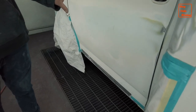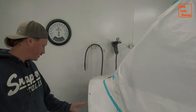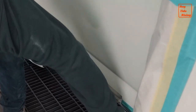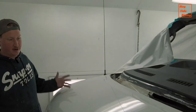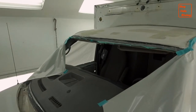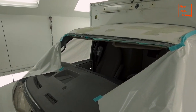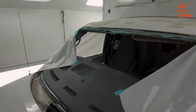On the front cab there's actual dent repair. There are a few dents on the doors, the roof had some pretty big creases and buckles. Same with the fender — small rust repair on the lowers and a couple of little p-dents. Down here they replaced the rocker panel because it was pretty rusted out after sandblasting. The back cab is just sanding, feathering, and priming. Up front there was actual dent repair. The hood is a new one — easier to buy new since there were too many dents and rust spots, plus hail damage and rust on the inside. The roof had a big buckle, likely from someone standing on it. They hammered it up and repaired a couple of little creases with a little bit of filler.